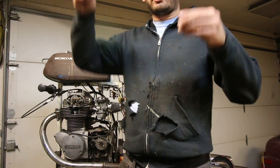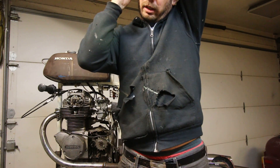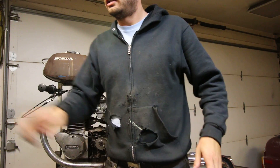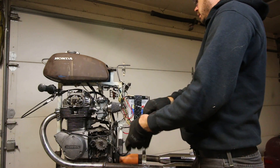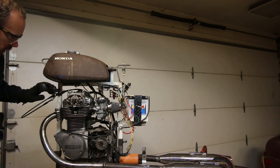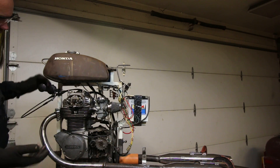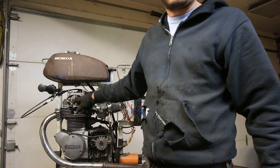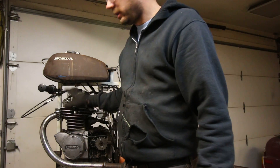Since I'm indoors, I like to have earplugs in when I fire the bikes up — I think you can hear the engine better. It cancels out a lot of the noise you don't need to hear. I have a fire extinguisher and safety glasses. I like to wear gloves just for the hell of it. I'm going to lock down the front end and double-check everything. I like to leave my points cover off when I test an engine — I like to see what's going on. If it sparks a lot, the points are dirty. I always like to see it flutter and make sure that both of them open the same amount.